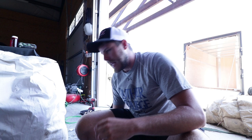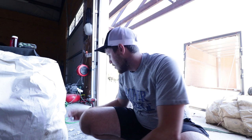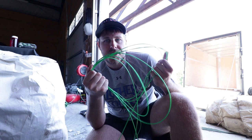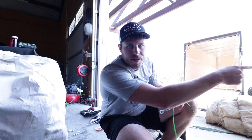I've got a few things that we're going to be using. I've got some eye bolts here - we're going to drill through the studs in the ceiling, run these eye bolts through, and then I've got turnbuckles as well, and I've also got a bunch of this PVC coated cable. The game plan is to run these eye bolts through the studs in the ceiling, hook on a turnbuckle, and then run a cable all the way to the other side of the trailer - going short ways, side to side, not back to front.